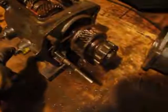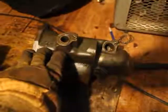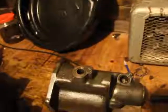So, a little summary once again. The first thing you'll have to do to remove the housing is remove this pin that holds the overdrive lever, I'm going to call it. Right there, just like the others. It looks the same. There's a little nut outside with two slots on each side. So you'll remove the pin that holds it, and then you'll pull it out, okay? It'll come out about an inch or so. And if the pin's still there, it won't come out, because it holds on to this thing here.